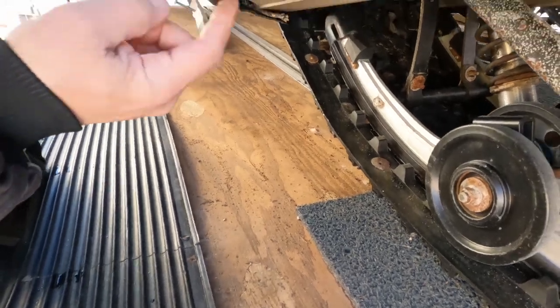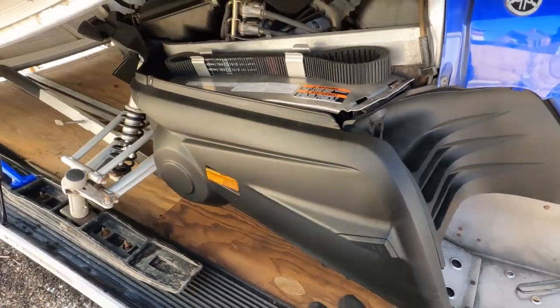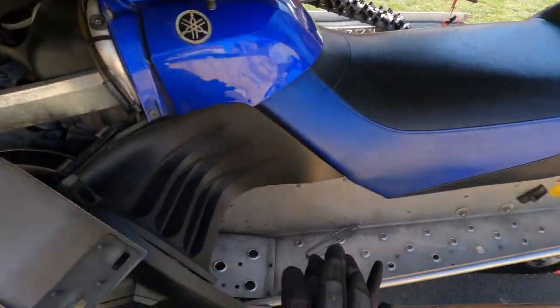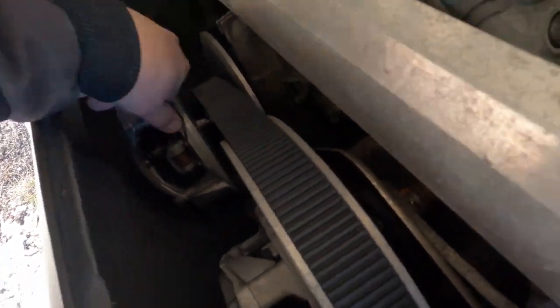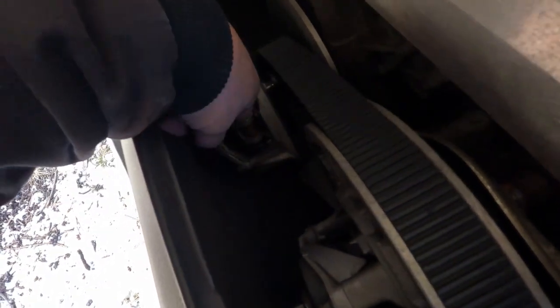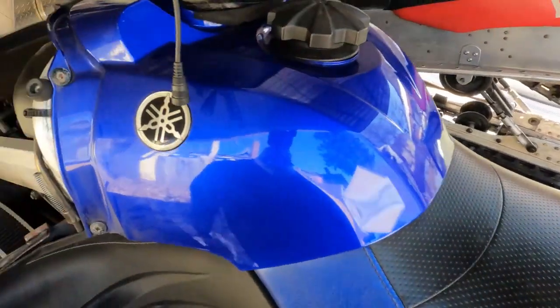You're gonna have to fix this right here — that's got to be fixed. Here's the cover, lift it up and slide it off. Down in here you can see the clutch. You can see where the kit puts o-rings right in here. You can really see that well, and you can hear that rattling. That's what rattles. Let's listen to it now with the cover on.